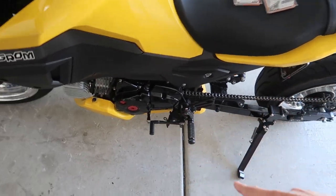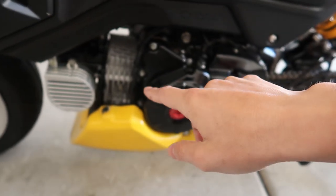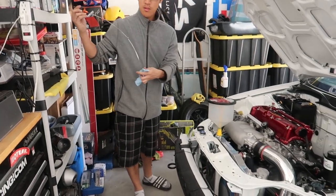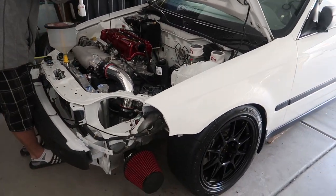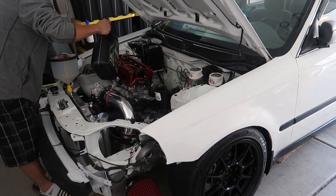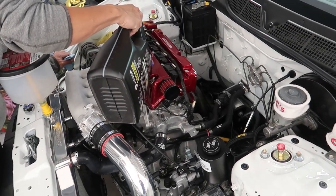I also picked up new engine plugs — Driven Racing, nothing fancy. I wanted to get rid of the red ones because they were an eyesore. Before that I'm going to pull out the tappet covers and recheck the valve lash, because these motors are quite ticky — regular 125s are really ticky, and once you go big bore they take a lot more. It doesn't hurt to double-check the valve clearances.